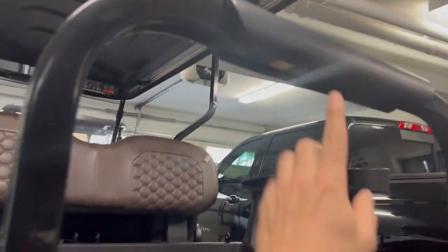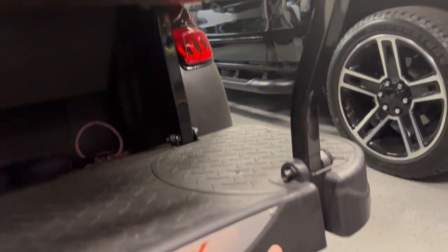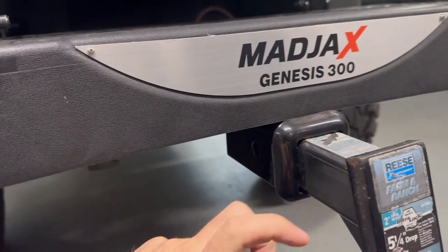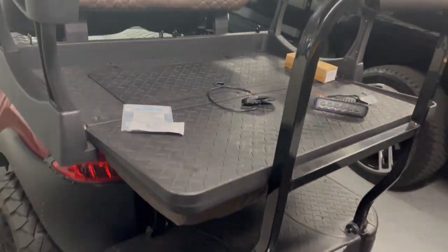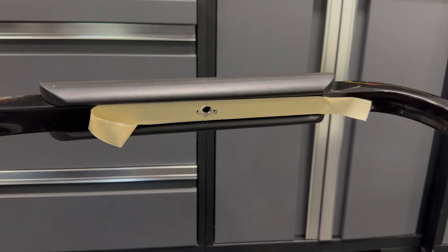As far as that backup light, we'll drill a hole here, run the wires down out this bottom, and I'll put it into a loom all together and we'll shoot that out to the front. So I'm going to work on that for a few. Be back with you. All right, step one, drilled an entry hole for wiring.